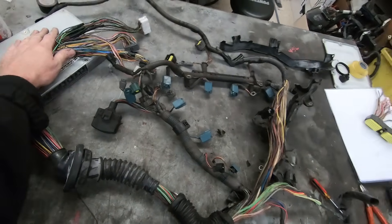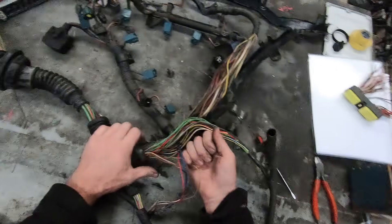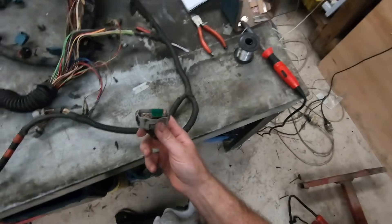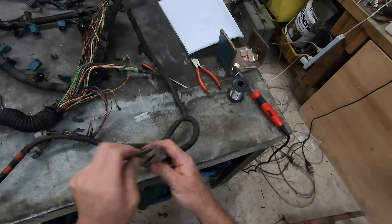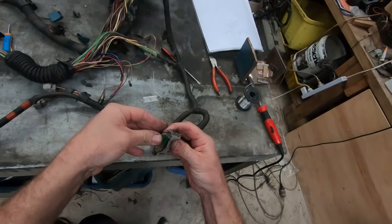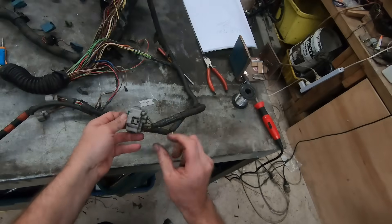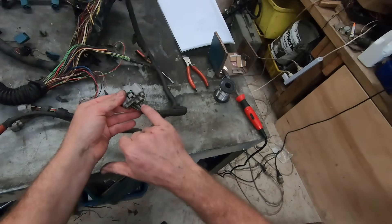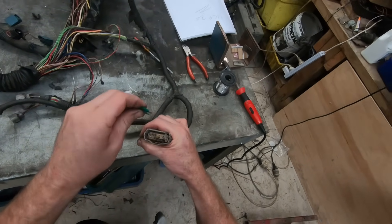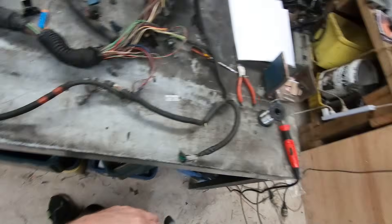Remove the wires — the early ECU will think it's in gear. Very, very, very simple. Now that's interesting — this one, for the start inhibit down in here, was bridged out. Someone may have been trying to start this. So the start inhibit is these two big wires and the shifter switch, and you can just pop a fuse across them like that. That's very interesting.